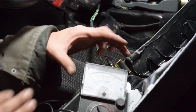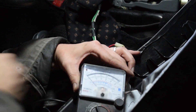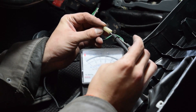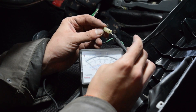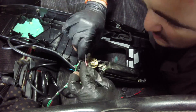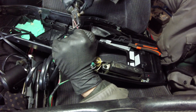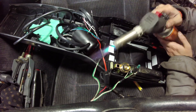To check which wires are positive and which are negative, simply get your multimeter and check for continuity between the wire and the positive battery terminal if you're looking for the power wire, and between the wire and the negative battery terminal if you're looking for the ground wire. Once you figure out which wire is which, disconnect your battery and solder the red wire from the X-Series harness to the positive wire, then solder the black wire to your ground wire.